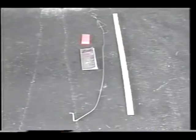This is a look at the Z tool set. This set uses one main tool to open about 600 different models from the 1950s through the present. The tool is augmented by a couple of plastic wedges, a window spreader, and a wooden stick to help hold the window open. The secret of the Z tool is to look the type and model of car up in the book, refer to the diagram for its particular type of locking rod, and then apply it.